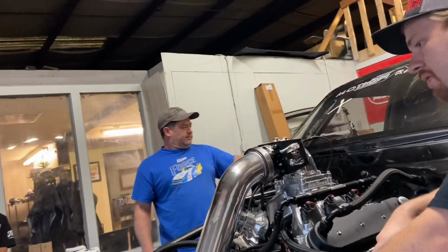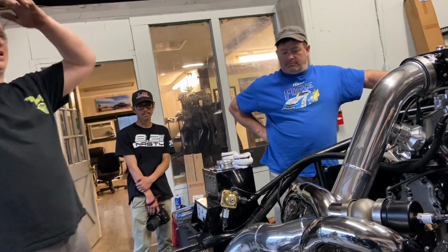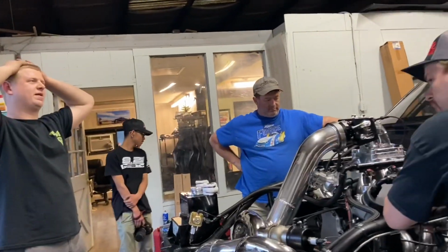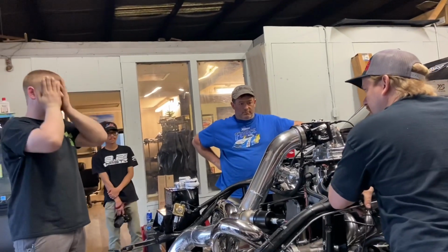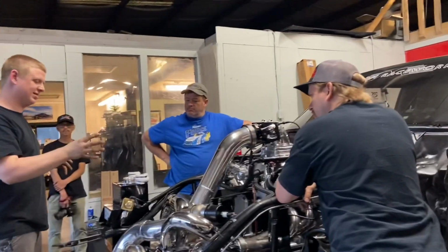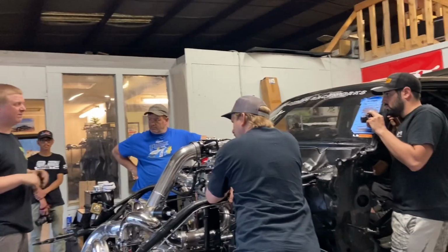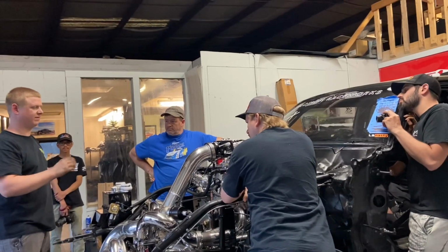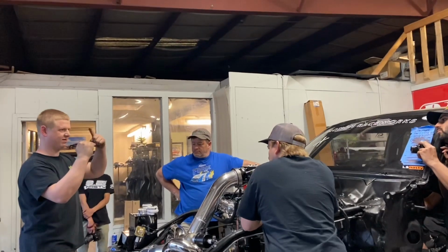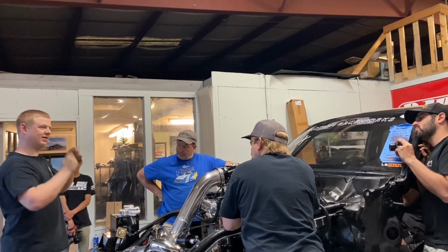See, what I did before when I had this problem: the cam, when this thing was fine, it basically tells it when to start. I mean, when the firing order starts over. Yeah, that's what I thought. But what I had to do before when it was out was adjust the bolt pattern in that reluctor up here. You can adjust it so that if your sensor's here and you got this much to move with, you move to the next pattern, and it's here, you can kind of get it around.